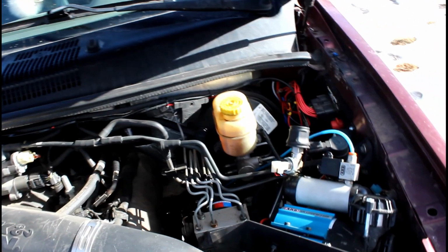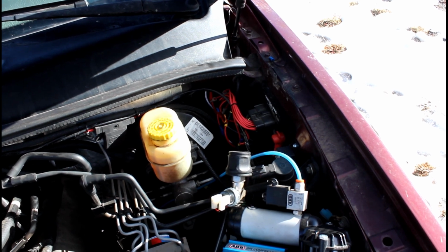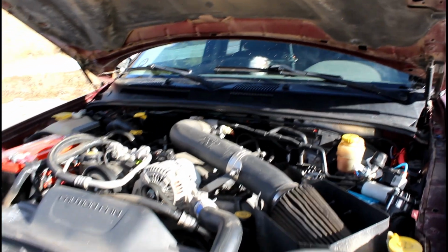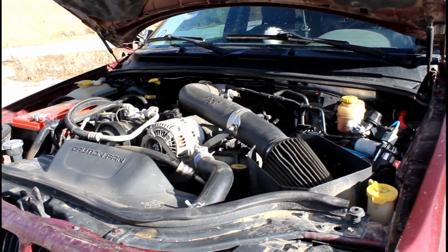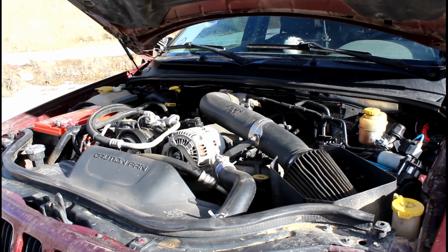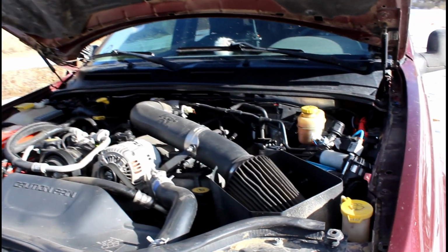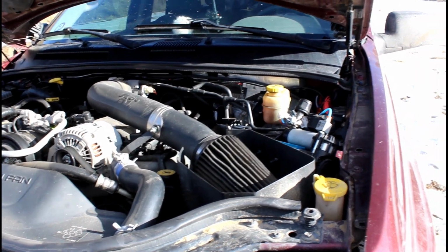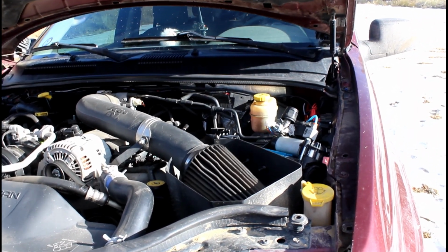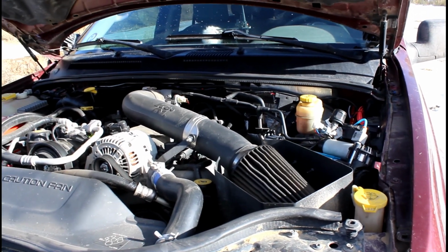Other things in the engine bay are the Switch Pro, which is a modular design that you run all your accessories off of. And so I run my lights, both the front pods and the light bar, the rear reverse lights, as well as the compressor is switched off of it and the locker is switched off of it. And it has 8 possible switches. I use 6 currently, and I could not be happier with the performance.